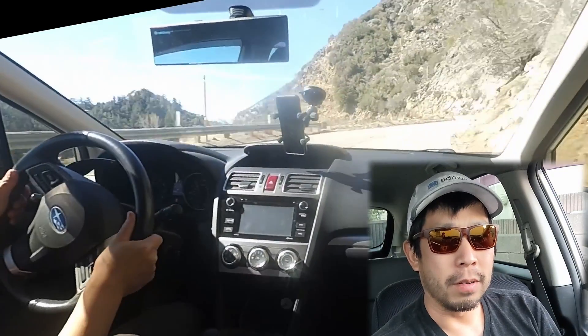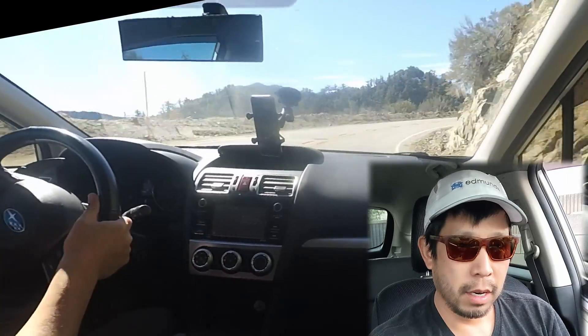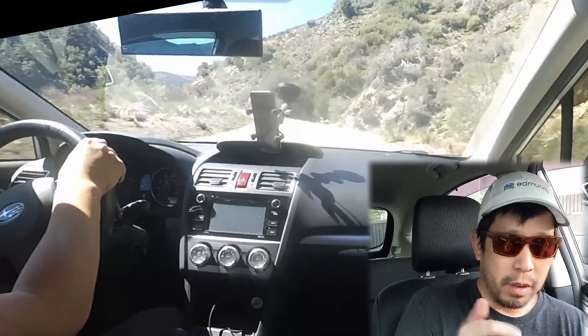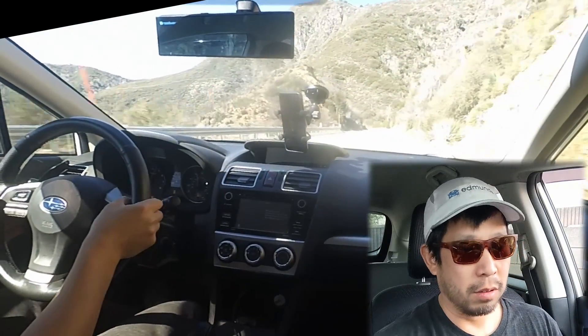I just came back from the shakedown of the lightweight water pump pulley. It looks like around 2000 RPM and up, the spin-up is a little freer. You can definitely tell — it's subtle, you know it's there, but it's a slight improvement. Every little bit you do to improve the efficiency of rotating mass in the engine, you can feel it in the pedal. Definitely.